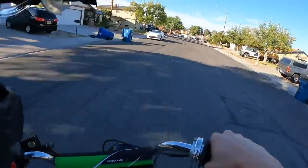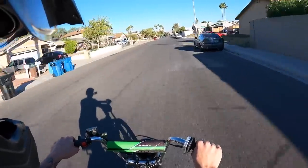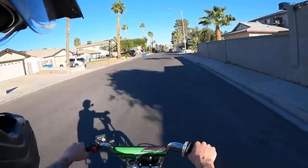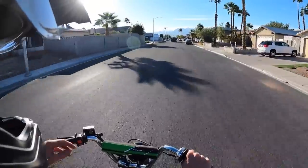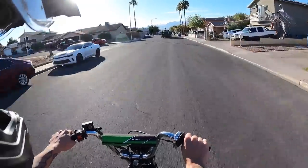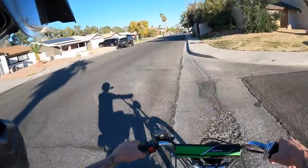It is squirrelly! Let's check the gearing. It's a little rich on takeoff, that's the only thing. The gearing changed a lot with that 13-tooth — we don't have much top end anymore. If I can get it to lean out a little on the takeoff... It probably only does like 45 now honestly, versus maybe 55 or 60 before. It seems a little rich.